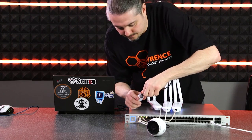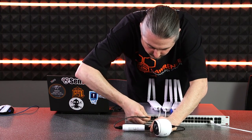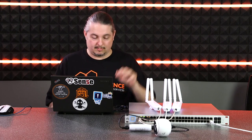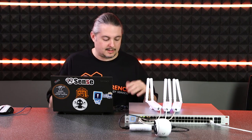We're moving over to port 7. With this adapter plugged in, port 7 will light up and you'll see how that works. If you don't have the adapter, you can set the switch port to passive mode to power cameras or other devices that support 24-volt passive. Please note — when you enable passive mode, the switch warns you that the device needs to support it, because it's just going to send 24 volts. Make sure the device supports it to avoid damaging the switch or the device.